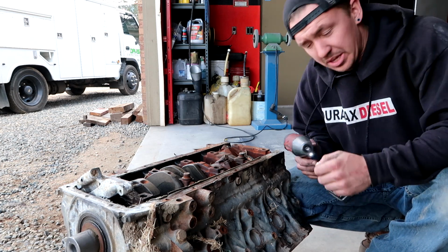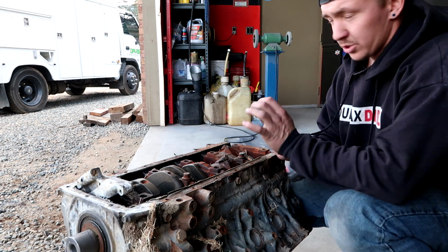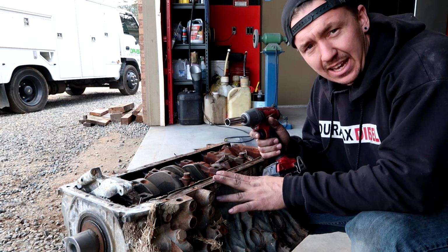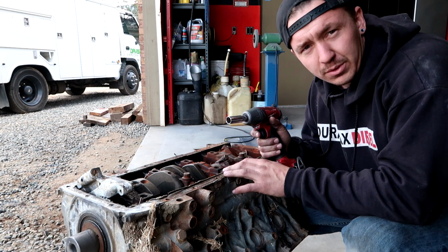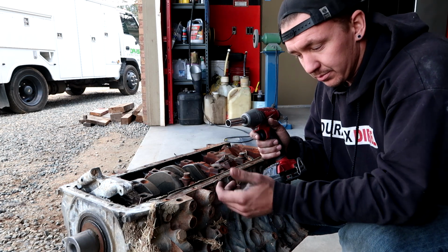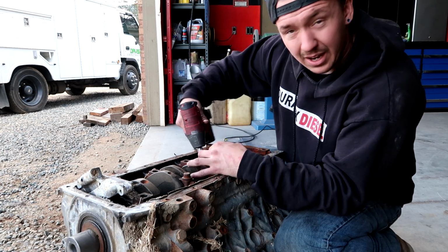So, as you guys know, the LBZ, LMM, and up have a little bit thicker connecting rods. So the goal behind this is to take these rods out, the LB7 crank that I have, get the cam and the crank keyed, use these rods and get some performance pistons. Get some performance pistons and have a mild 700-800 horse capable build. But I don't know, we'll see.